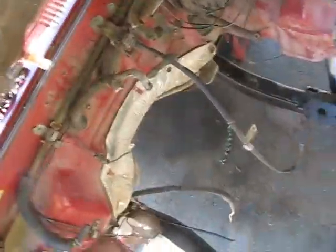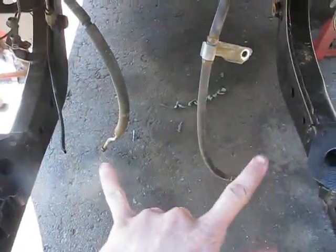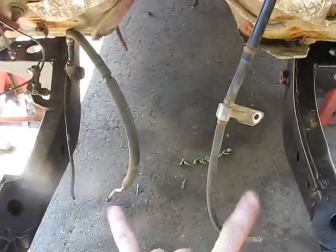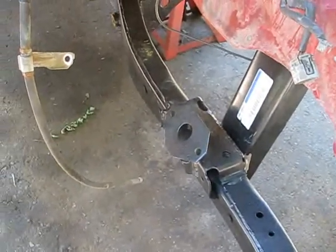I can't install the motor, not until I get freaking birds. Sons of... I need polyurethane motor mounts. Because those bushings that I'm using for the transfer cases, they're polyurethane. If I use polyurethane back there and rubber up here, the rubber is a lot softer than polyurethane, so the engine will twist and the transfer cases won't. So something's gonna break, and I don't want that to happen. So I need everything to be the same kind of strength, so polyurethane motor mounts is what I need, and they're about $108. So I need that. I need a flat pitman arm.